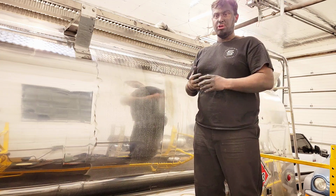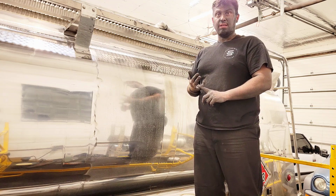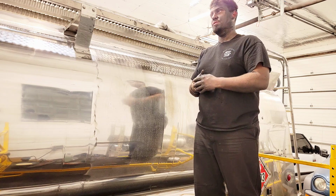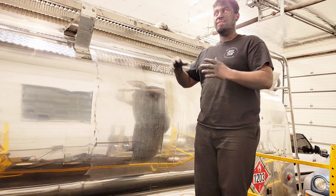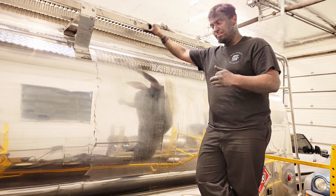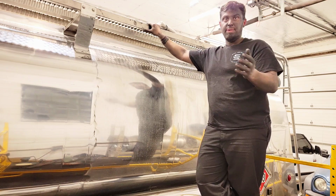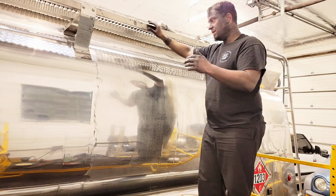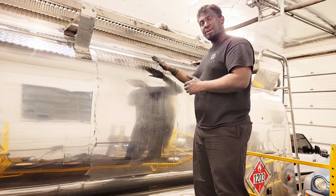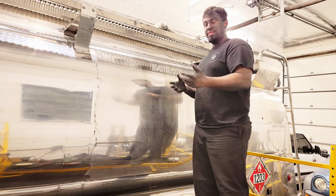There's a huge array of things. I don't know what you're going to be working on. You could be working on a brass lamp in your house, silver, fine silverware like silver platters and gravy boats and things like that. You can use an aluminum polish for that. You can use all sorts of different products to clean different varieties of metal. And a quick Google search will net you an answer to that fairly quickly. But most aluminum polishes or most metal polishes will do a large array of metals. But at the end of the day, they all kind of work very similar. What you're trying to do is rub that down, create that friction, create that heat, and that's going to break down that oxidation, and then you're going to end up with a shinier surface.